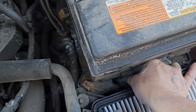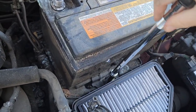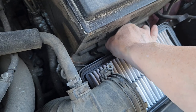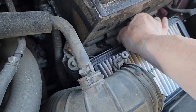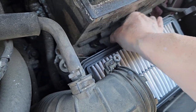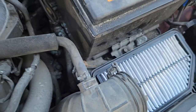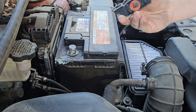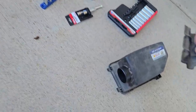This bolt down here — that's a 12 millimeter bolt. I already got it loosened up. Get that bolt out of there. Now's a good time to check your air filter to make sure it doesn't need to be changed or cleaned. It's kind of a long little bolt and there's not a lot of room to work. This is your battery clamp, or battery tie-down — whatever you want to call it. I'm going to set it over here by my air filter so I don't lose it.